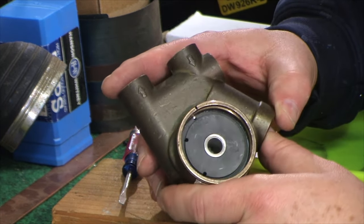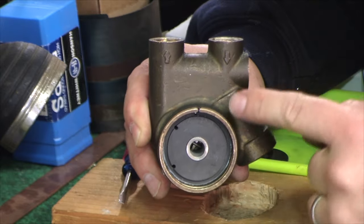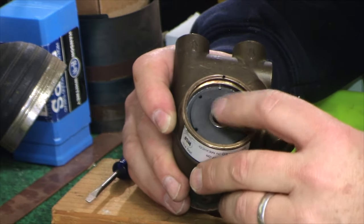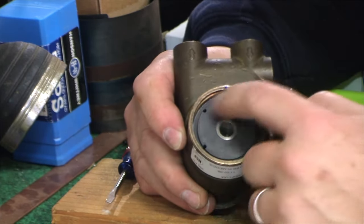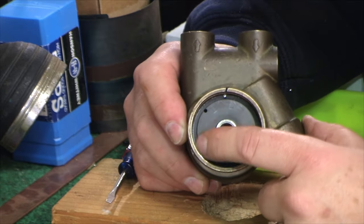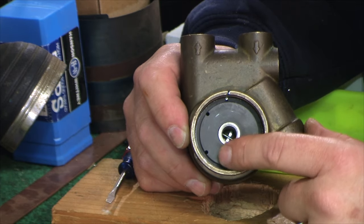If you clean the pump and lose your Sharpie mark, you'll have to kind of guess — but it's not hard to figure out where it goes back. If you look at your pump at just the right angle you can see the mark — it's top dead center right through there. Now it gets a little trickier because there are all kinds of parts.